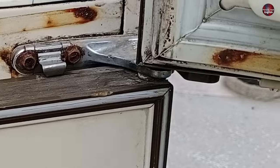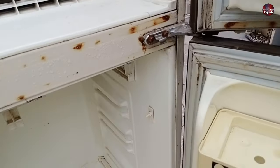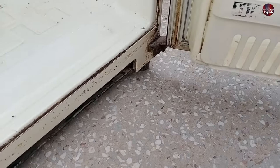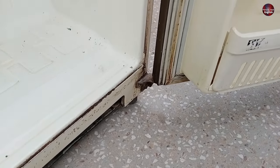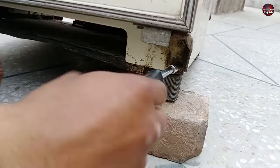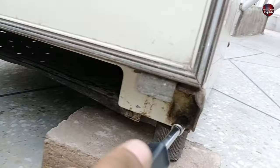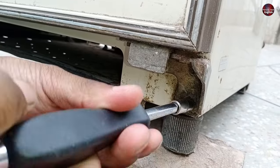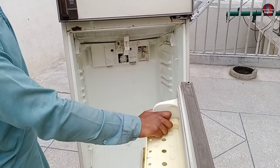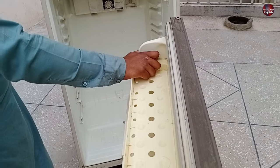I have to fix this play in the door. I will unscrew the hinge installed on the downside of the door. This way, I will pull the door down and make the door separate from the freezer's door. This hinge has three screws, which I am unscrewing right now. Then I will be able to remove the door from the refrigerator. I have separated and removed the door from the refrigerator body after unscrewing the hinge.